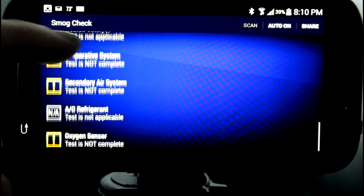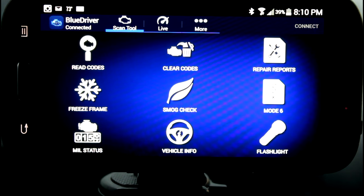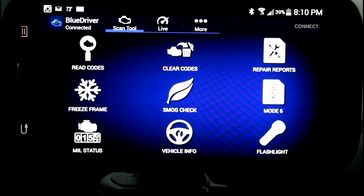If we go back one screen and do our smog test, now we'll see that the light's off and the readiness is not set, but we also have no codes stored. You can see here where our readiness monitors are yellow, not green. That means in North Carolina, for example, when we do a state inspection, we hook it up and check those readiness monitors to see what tests have passed and haven't passed, which gives us an idea of the condition of the vehicle.